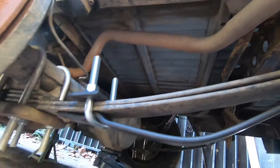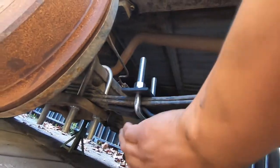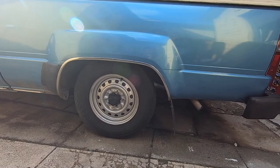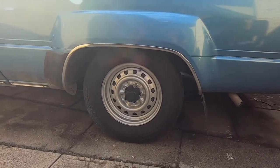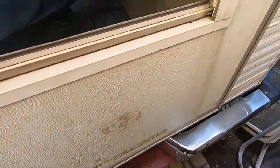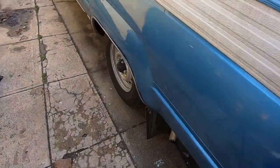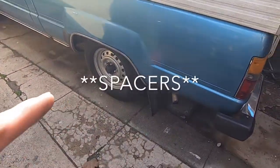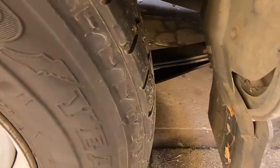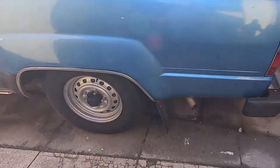Now we're going to go to the other side, start grinding off the rivet on that side, and then install the leaf spring helper. Remember, we didn't use the pin on any of these because we wanted the light load setting. The truck is now sitting about a quarter to a half inch taller than it was, and we did the bouncing test — it doesn't feel too stiff. We're going to drive it once we do the adapters in the back. Follow us on Instagram at yonke_oxc_films — link in the description. Catch you on the next one.